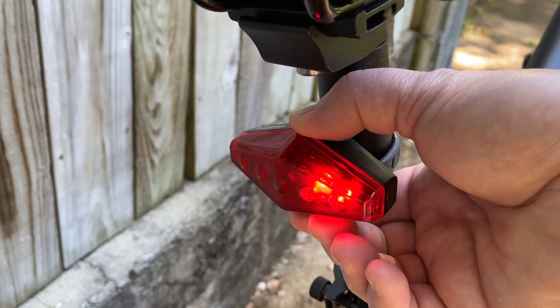The Voxa suspension fork was said to have 110mm of travel, but measuring the grease marks I only get 80. It's a tapered fork, so not a deal killer, but not great — and it's being pushed on by a bike that weighs 56.6 pounds, so I'd probably swap it out. The head tube angle is 70 degrees, steep even by big-box bike standards. The rest of the frame, however, is attractive and appears well built. The suspension mounts and pivots look like beefed-up versions of those on the Hyper Hydroform — I wish they hadn't also kept the same nylon spacers.